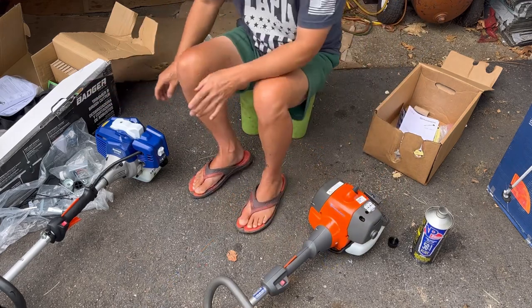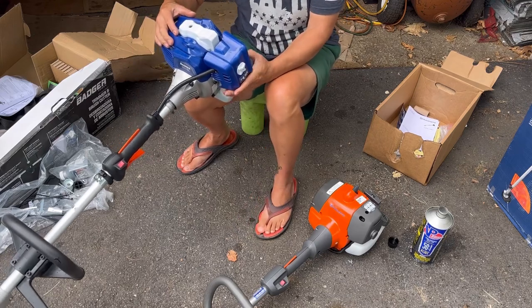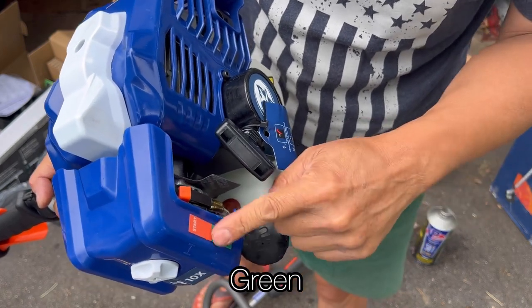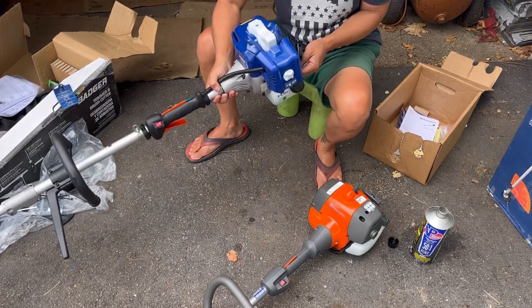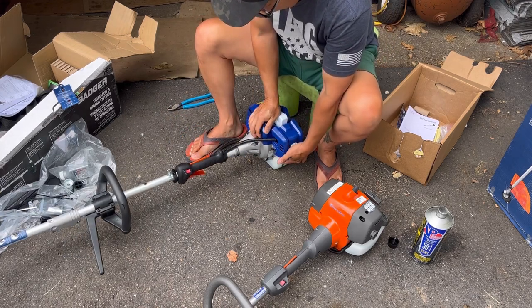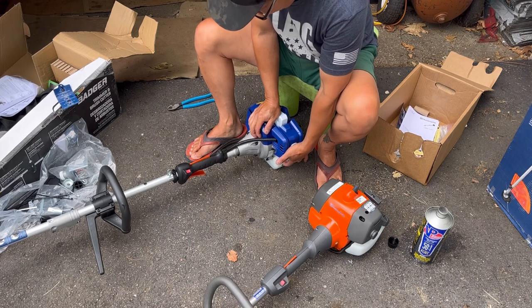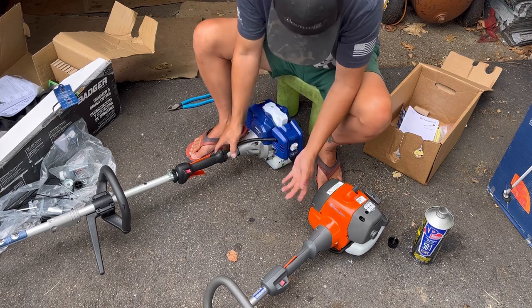Since we poured the gas for the Wild Badger first, we'll try to start this up now. There is a primer bulb on the bottom. Start orange, run red. Okay, we're gonna put it to start. We're gonna remove this. Now we'll prime it. Primer bulb is on the bottom. For the very first time, you wanna make sure that you're sucking the gas up the fuel filter and the return line's coming back, and the fuel is coming out the return line. And I feel fuel readily going through both hoses, as well as the primer bulb. So that's like 15 right there.